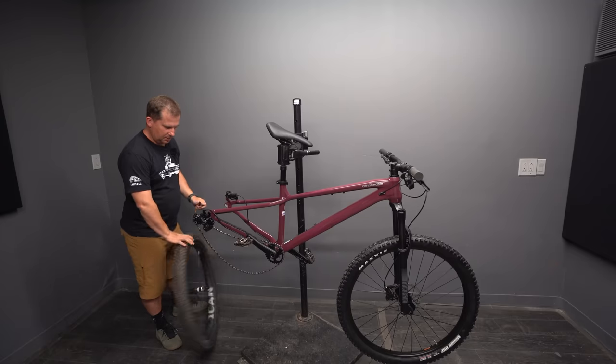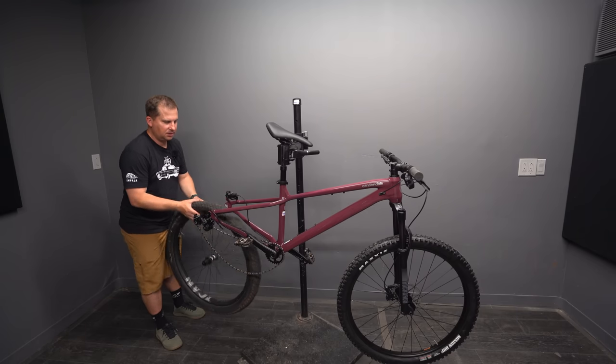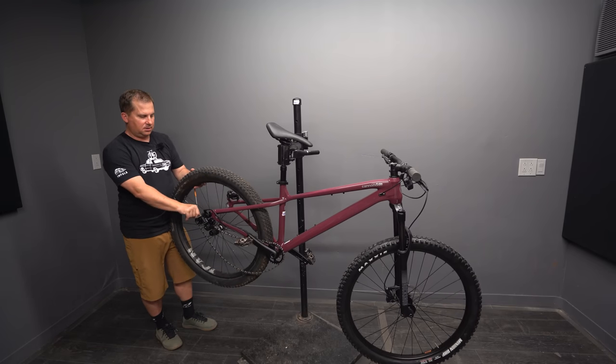Let's go bigger. I highly doubt this will fit because most bikes do not fit a tire this big. 29 by 3.0. I love getting nerdy.